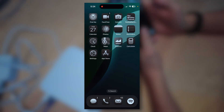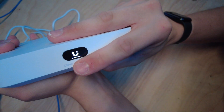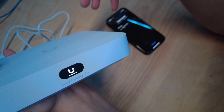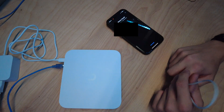It's just the UniFi app for their UniFi network. If you scroll over to your homepage, you'll find the UniFi app — open it. You'll see up in the top right-hand corner a plus sign. You're going to click the plus sign and it's going to find nearby Ubiquiti devices that are ready to set up. You'll want to wait for your router to boot all the way. You'll see the progress bar at the bottom of the screen on the LCD screen. Just wait for your router to boot up and then we'll continue with the setup on the app.